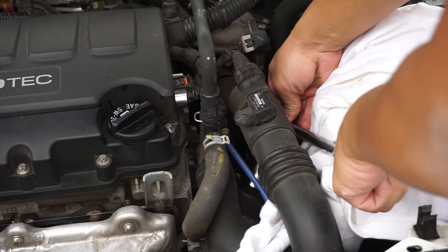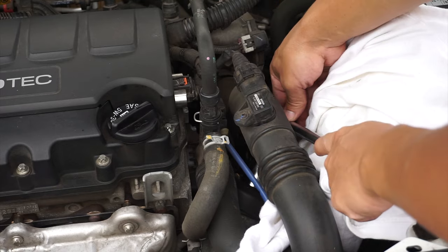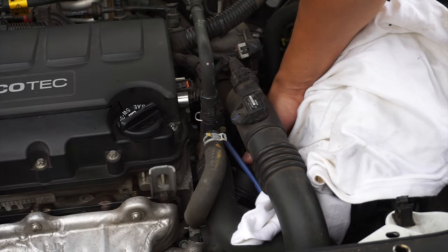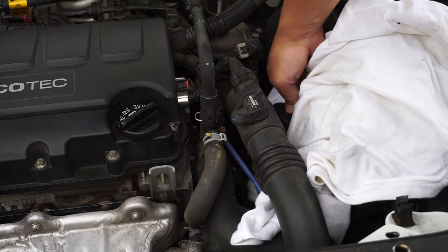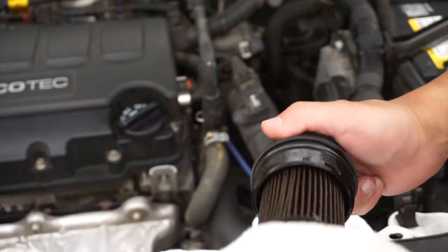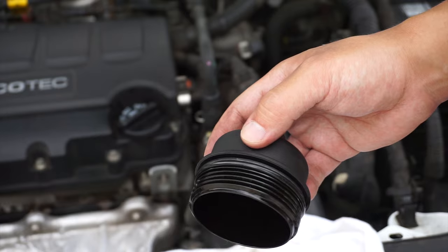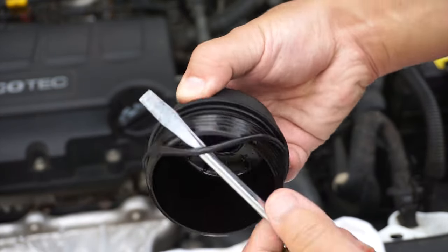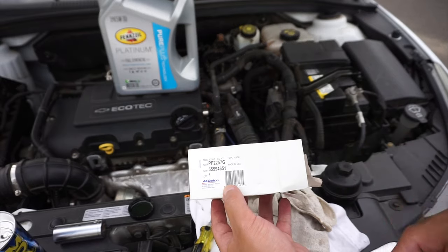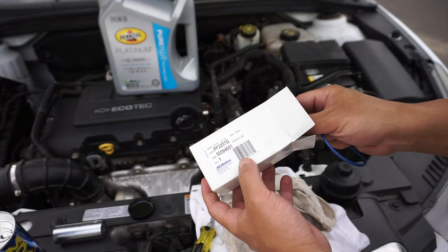I always like to put something down underneath to make sure I don't get oil everywhere. Just loosen it up — if I had a little extender for this size socket I could have a little more wiggle room, but not a huge deal. Once you've got it loosened, completely twist that off and pull the cap up. This is the kind where the filter is actually in the cap, which is one reason to put something underneath to catch some of that oil. The old filter should just pop off — just compression from the knobs holds it in. You also have this O-ring, and you'll find that a new O-ring always comes with the new filter, so take off the old one and throw it away. Today we're using an AC Delco filter — I'll put the part number in the description. In general you can choose whatever you want; I'd probably go with Wix or AC Delco.